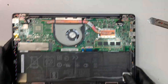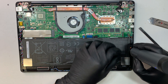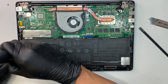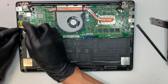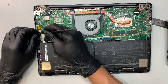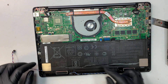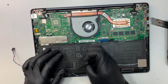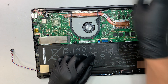Now let's take a look at the battery. The battery is held on by a few screws. I see there's a Phillips screw — that's one, and that's the second. This is the speaker; you'll need to disconnect the speaker as well. For the speaker connector, you just want to slide it down to disconnect it. Then work your way around it. There are also more hidden screws underneath the rubber, so remove those two screws.